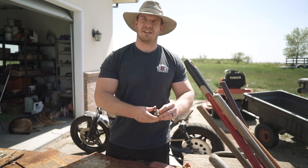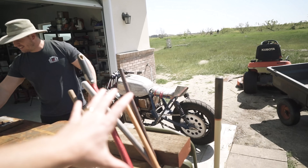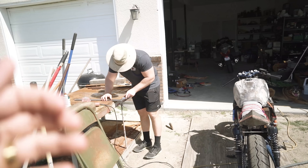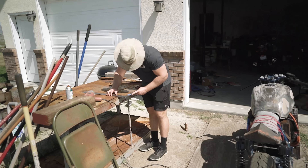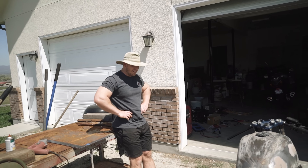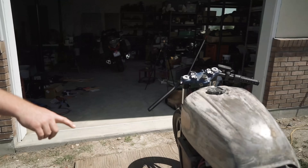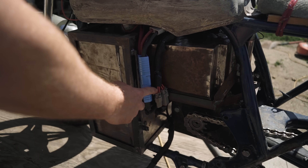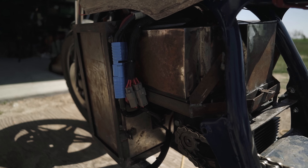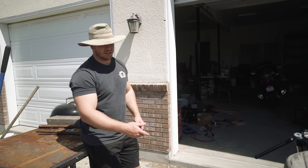The weight of the battery is more than compensated by the power that it delivers. Both packs are fully installed. They're connected in parallel from full discharge, and each pair of cells is also connected in parallel — so this wire connects cell 14 to cell 14, cell 15 to cell 15. Everything charges and discharges together, with one BMS now controlling both battery packs. That's the reason those cables existed.